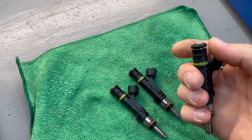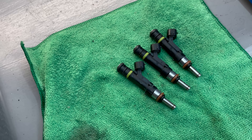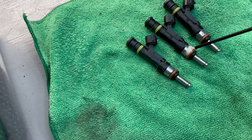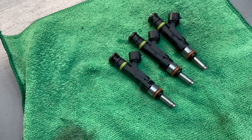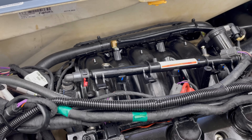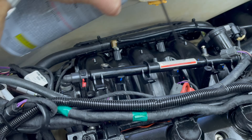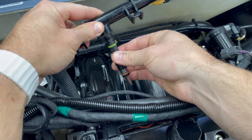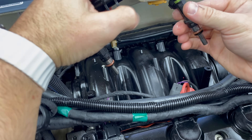This is a brand new ski obviously, so these injectors are still in excellent condition. But since we removed them and we are going to be putting them back into the fuel rail, I don't want to put them back completely dry. So I'm just going to put a small amount of lubricant on the O-rings just so they don't get pinched when we're putting them back in. These skis are winterized and as I mentioned in my winterizing video, I generally spray a little bit of fogging oil down into the injector hole. So that's what I'm doing now. And now I can go ahead and put the injectors back into each one of the slots here, making sure not to pinch any of the O-rings.